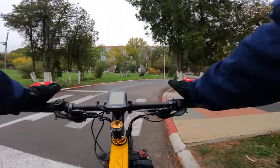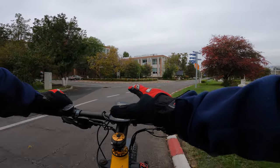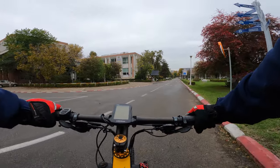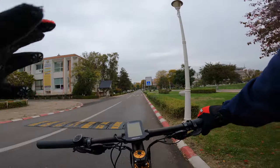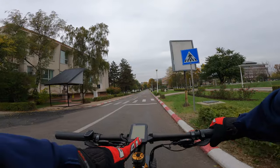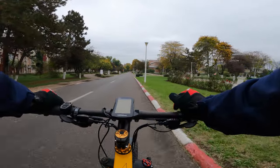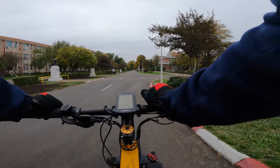Although I need to caution you, and this is very important, if you get this bike on the first about 10 kilometers per hour, the brake didn't hold at all, and even if you squeeze the brake lever as hard as possible and you can feel it blocking, it would not stop the bike. Because the brake pads are new and the disc is new, and they are somehow shiny but not oily, they are not yet bedded in, so you need to be cautious with the brake at the beginning. And now I have 90 kilometers, just 90 kilometers, but the brake is starting to hold very well, and you can actually lock the wheels now. But you need to take caution with that, because when you get the bike, the first thing that you are going to see is how fast it goes, and you are going to find yourself not being able to stop, and that's very dangerous, so take care with that.